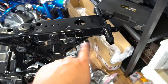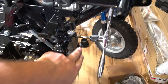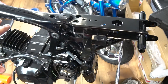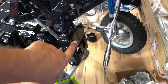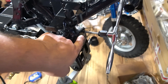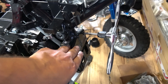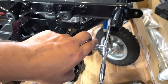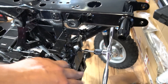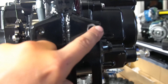Next up I'm going to put the fender on. I always put my rear fender on first before building around it, because you've got to get access to these little holes. This is powder coated, so I chase the M6 by 1.0 threads in the frame, because you will break an M6 bolt if it has too much tension on the thread area - it will snap. It's better to clean out the areas where you're putting bolts back in on the frame. Use an M6 by 1.0 tap.